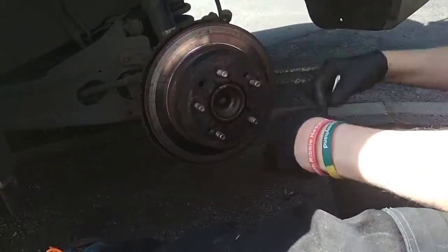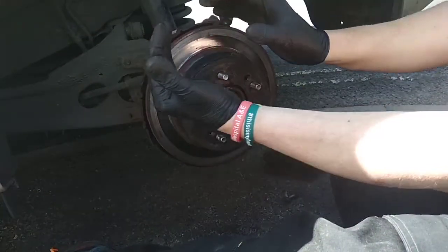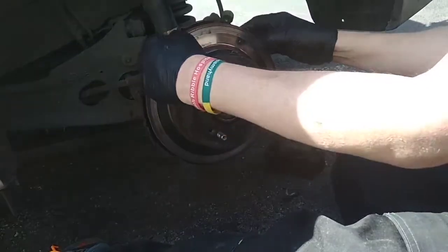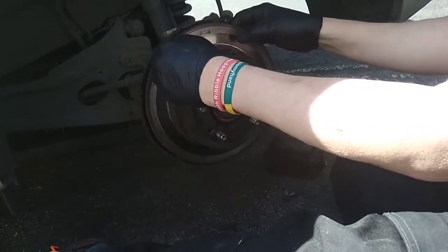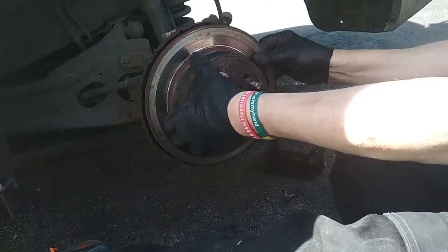What you've got inside here is the handbrake mechanism, which is effectively like a drum brake — the pads are engaging with the inside of this disc. That means there's a groove on the inboard side of the disc stopping you from getting this disc off.